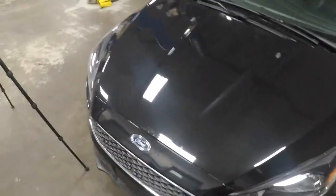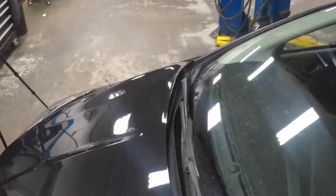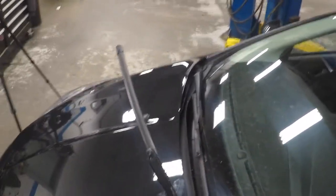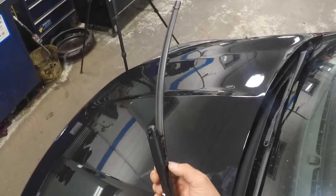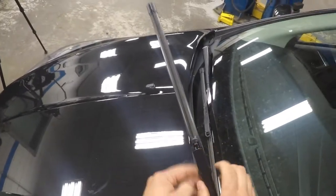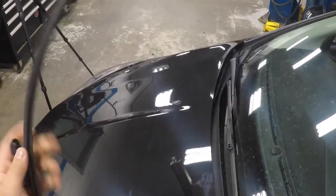The first one, we're going to show you a few different makes and models here. We've got a Ford Focus here that we're selling on the used car lot. We're going to show you how to change the wiper blade on this one. So if you look here, there's a clip and this is the style that this blade is — there's a few different styles. You can see there's a couple of tabs here; some of them you actually press in, these ones don't. But you can see there's a lock here on the end. So we're going to push this lock ahead which allows that to roll ahead, and then we slide it back — and that's as simple as that to replace your wiper blade.